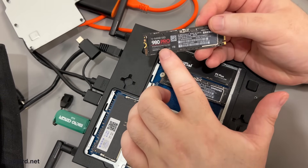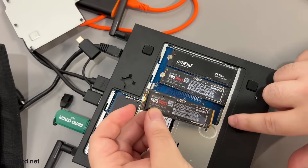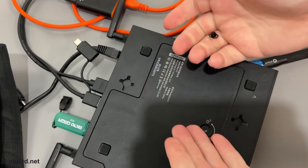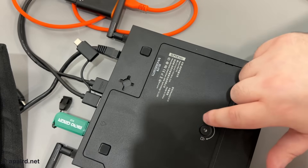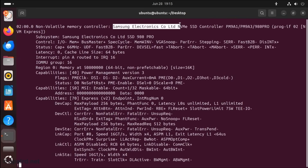I've got a pair of Samsung 980 Pros — these are PCIe Gen 4 x4 — and I'm putting them in the extra slots to see what bandwidth they get. I love this easy-access cover. Even if the hand-tightened screw really needs a screwdriver, it's one-screw access, which is very nice. And sure enough, the Samsung drives are running at PCIe Gen 4 x4. Sweet.